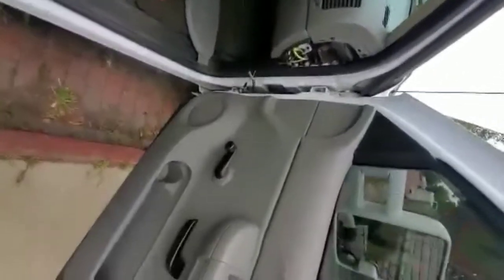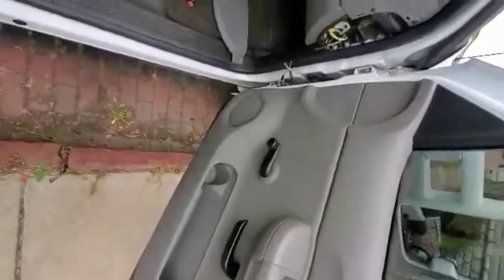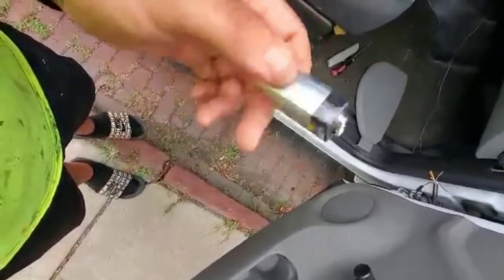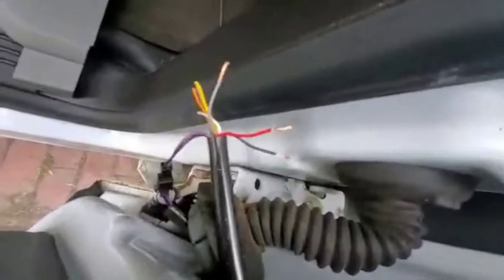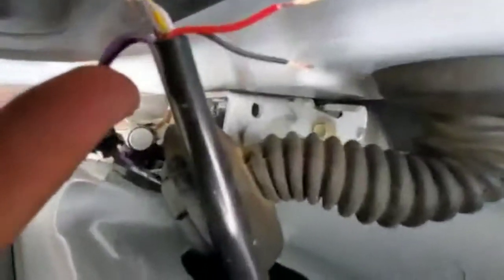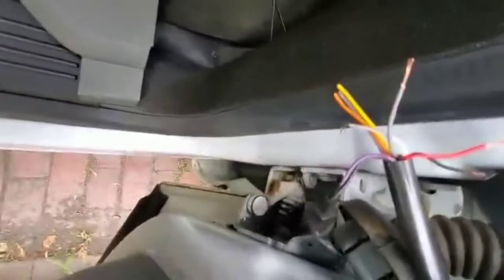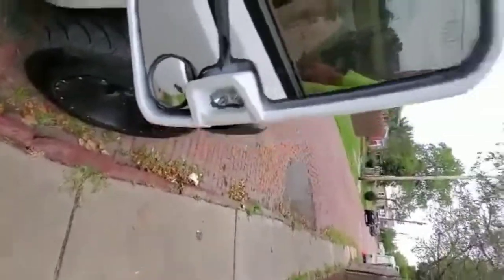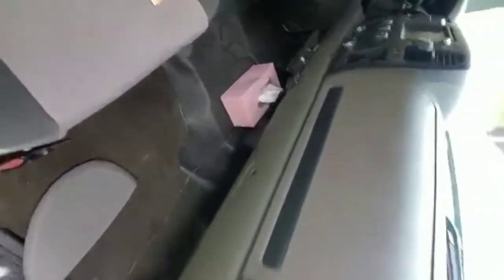I've never done this before but it's kind of self-explanatory. If any of you are gonna do it, I suggest getting one of these — a little 9-volt battery. I'll show you what it's for in a bit. So you got a bunch of wires here — these are what came with the mirrors, this harness right here. Then there's a purple and black wire — that one is for the flood lamp or reverse light, whatever you want to call it. I'll show you guys everything and how I'm gonna run it, but a lot of you are gonna have to tap somewhere different.